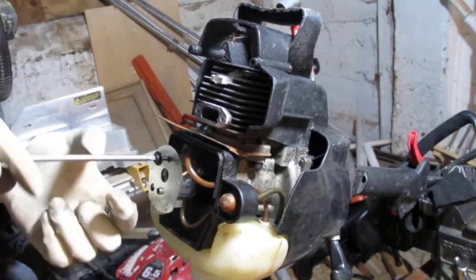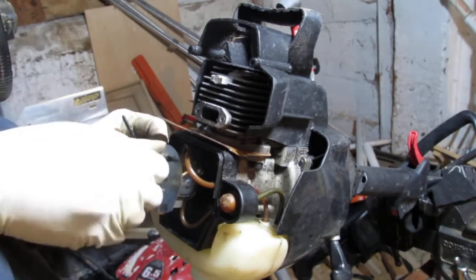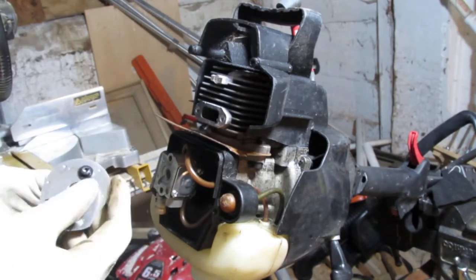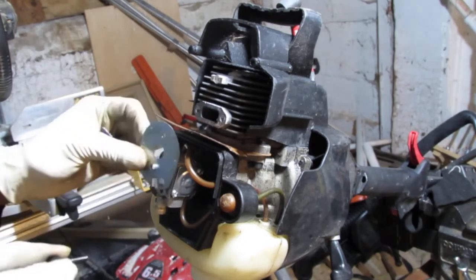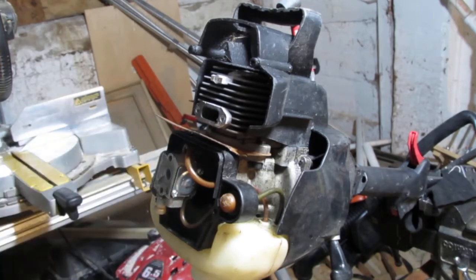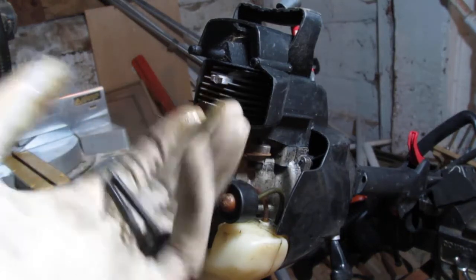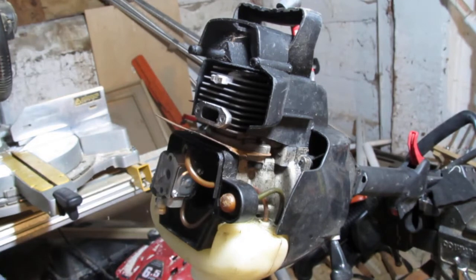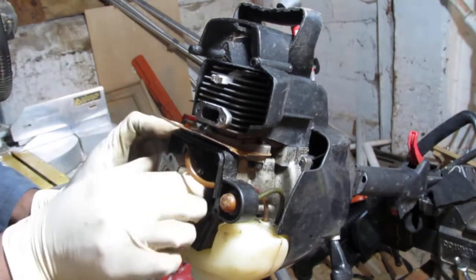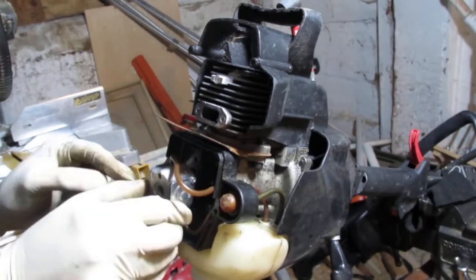The threads on these are a little thicker, so that's interesting. Does it follow the same convention of screwing into plastic? I think they do screw into plastic. We have two longer screws here with washers that held that on. We have the carburetor here, and that'll slide right off. These fuel lines are petrified. Be careful on the back side — we have to disconnect the linkage.